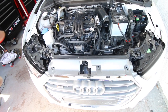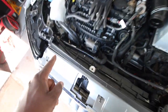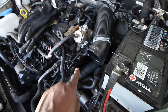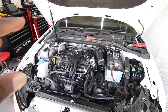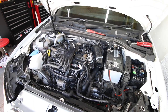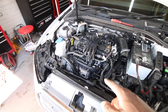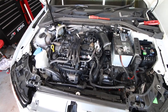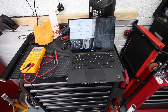The other issue that causes this is the temperature gauge. On this two-litre TFSI engine there are two temperature gauges: one in a pipe at the exit of the radiator and one on the engine block. The car measures both of those. Since this car doesn't have a temperature gauge inside the vehicle, the only way to check is to get it running and up to temperature. The suggestion was that the electronic thermostat - which is underneath this manifold - hasn't opened up and allowed water to flow through.